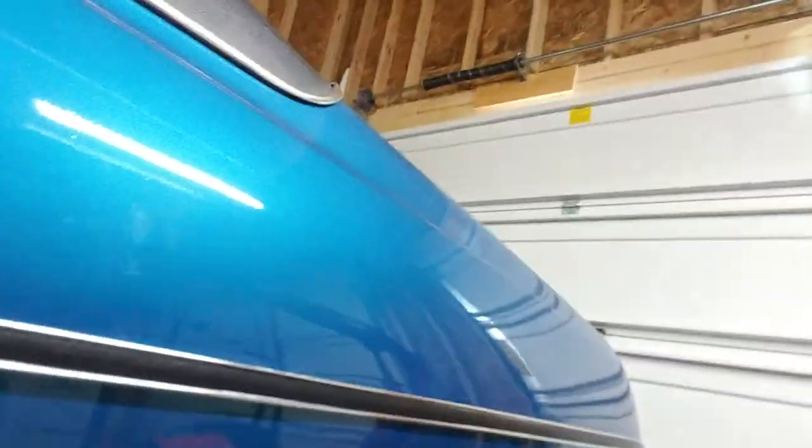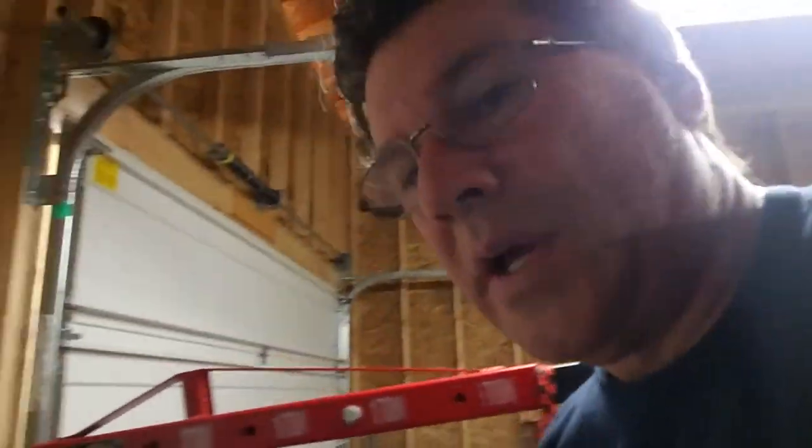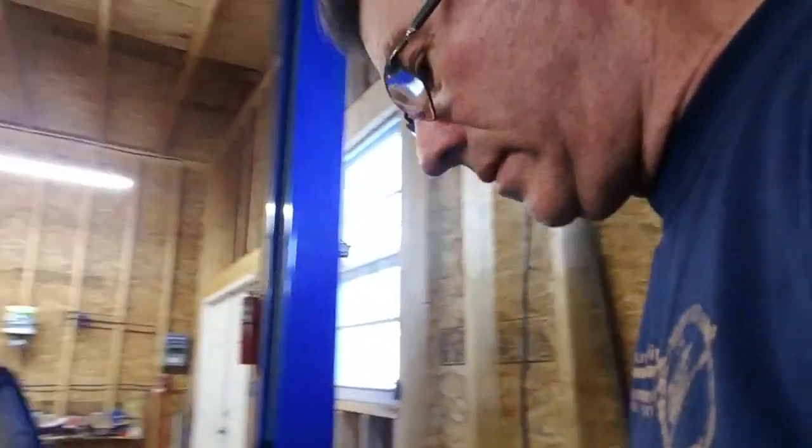Okay. And the inside, I've got a mile. I got like an inch and a half room. I wish that these wheels came with a six and a half. What have I got? Five. A 6-inch backspacing would have worked beautifully. It'll fit, but it is super tight. Might have to shave that part of that fender off right there.